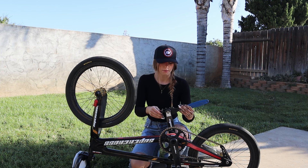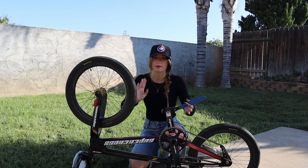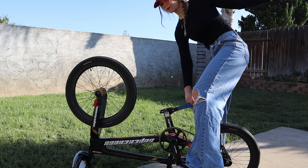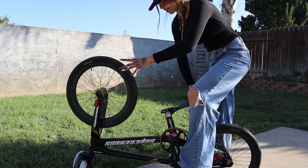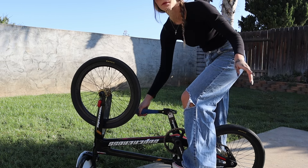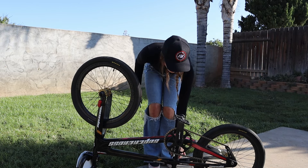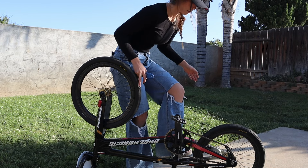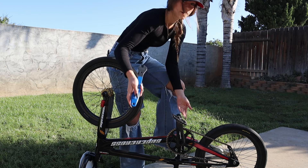You're going to take your wrench, put it right here, and what you're going to do is push your wrench towards the front of the bike — because it's upside down, so you're not going backwards. You're pushing it towards the front of the bike, and you're going to get on the other side because your pedal should be tight, and you're going to put leverage down on your other pedal. So you're going to stand on it right there so that the bike doesn't move, then go forward with it. It'll break loose just like that.